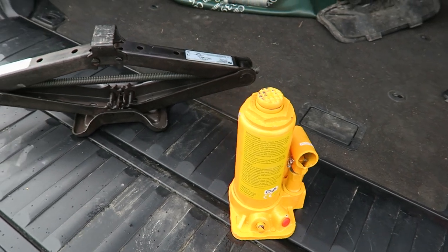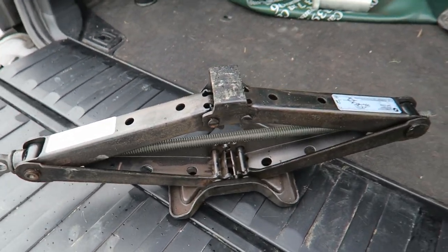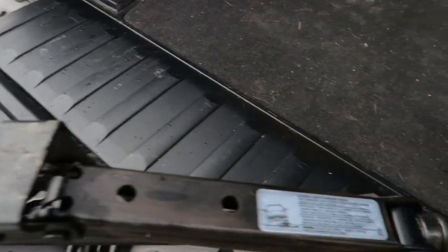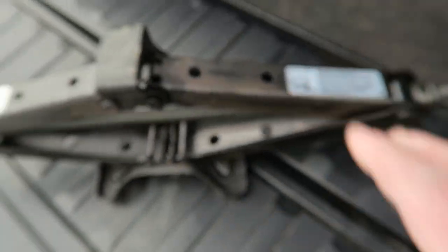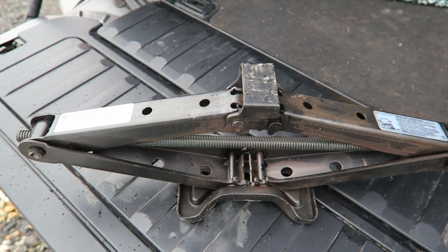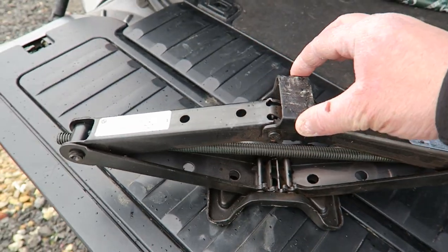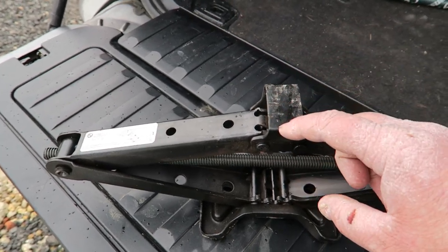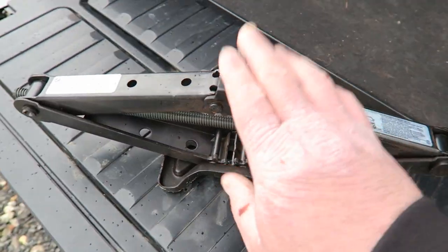Let me take a moment to talk about the jacks you can use. This is a scissor jack from the car. It may not be suitable for use on the caravan — the thing to do is check the weight allowance. This one is rated for 1,200 kilograms, which means it would be okay for our caravan: our caravan is 1,485kg MTPLM and we're only lifting half, so well under 1,200kg. However, I wouldn't recommend using this because it's designed for the car, it's going to slip as there's nowhere for it to grip, and it's notoriously unstable.